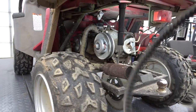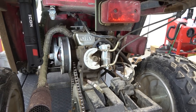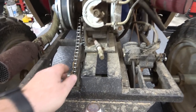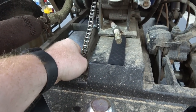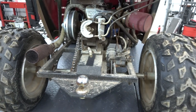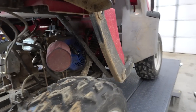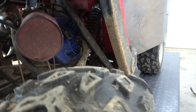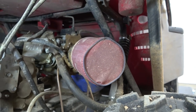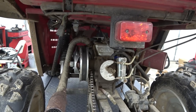This is the best belt to use with this setup because you can get the right placement from the gearbox. You can see the gearbox is almost touching the valve cover - it actually is touching the valve cover just by a little bit. That's the only way to really fit this thing in there. I noticed one thing - his sprocket turns like a quarter of a turn before grabbing. So I wonder if his key is almost broke all the way through. We've had keys separate like that. Another thing is we can start it but it will only run on choke. So we're going to have to pull this carburetor. You can see it's got some buildup on it from fuel leakage. So let's get the carb pulled off, we'll get the collars pulled off of the sprocket, and then we'll also switch out that belt.